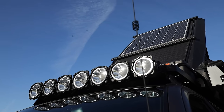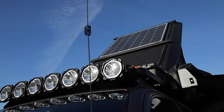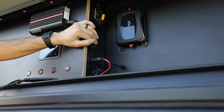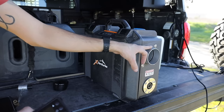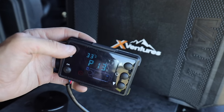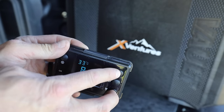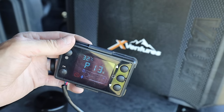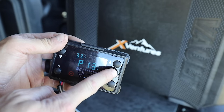I have a 100-amp lithium battery powered by a 200-watt Redarc solar panel on top of my rack, so I never have to worry about this diesel heater dying on me unless I run out of fuel. Since we're not camping today I did go ahead and remove the hose just to give you guys a clearer view. All we're going to do now is prime the unit before using it — push the up and down buttons together and you should hear the pump go off. Now that the unit is primed, all we're going to do is simply turn it on.